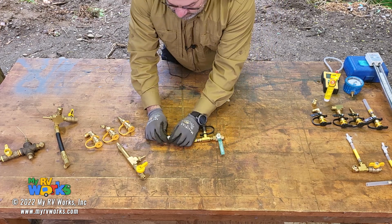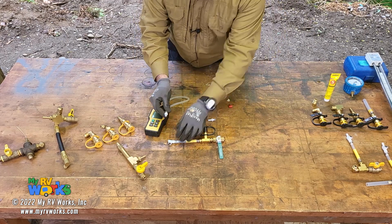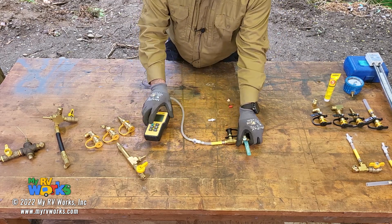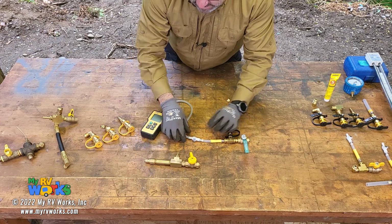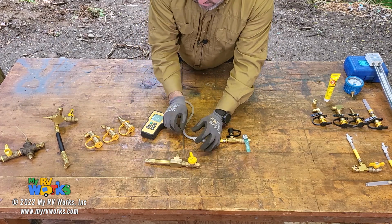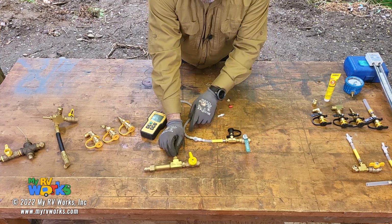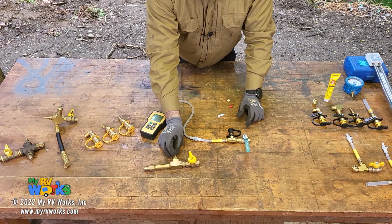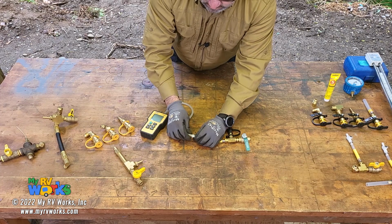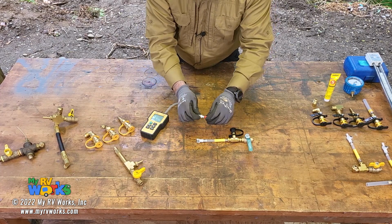Now on my manometer, I made it so that the manometer now has a quick connect. So now, just like that, I connected my manometer, whereas with this one, I had to take my silicone hose and plug it on and unplug it, plug it on and unplug it. And what I found was when I did that, I would fatigue over time. I was fatiguing my silicone, and it would cause a leak. So I came up with this quick disconnect design. So that's kind of a neat feature that I enjoy. And then I put a little cap on it to keep it clean.